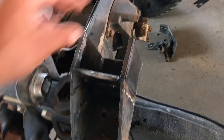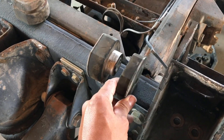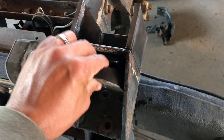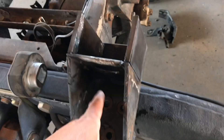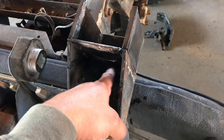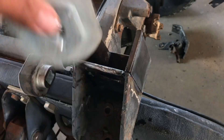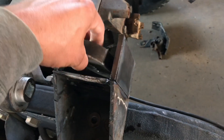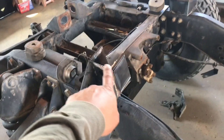This thing was fully boxed in and I went ahead and used the plasma cutter to cut this front piece back out. The reason I had to do that is because I completely forgot that the body mount bushings were a two-piece — an upper and a lower. The upper part goes through the top and the bottom one goes through the bottom, but because I had that piece on there I wasn't able to get through it. I could either cut the bottom piece out or cut the front piece out, but I figured it's better to just cut the front piece out so it just drops right in.